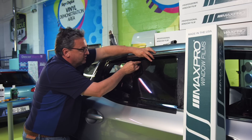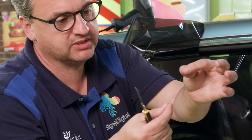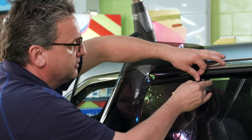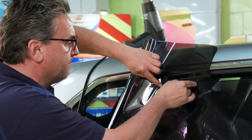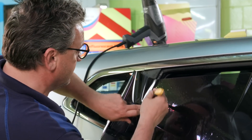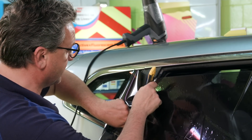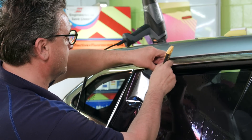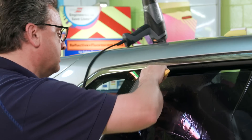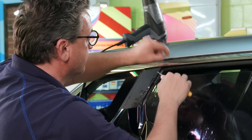By adjusting, look at this little tiny piece — you can actually cut it out, small tiny millimeters, just to be sure you have a perfect cut up here. Knead it up there and hold out here — now straight out. And now it's time to go down here because this window is angled like this. Go down and find my corner again, have a finger in front of it, and lay it down. Look here — now I have actually a very bad cut here, it's not fitting to the car. So what I will do: lay it down and then trim it up. Trim it up, trim it up — there you go.